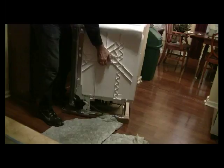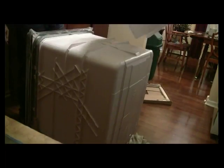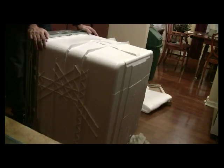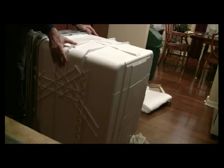These are pretty light. I'm just going to pick this up and set it right like so, making sure I'm on the pad itself. This does have a thermal pad. You can take it off and lay it to the side for now until after installation, but make sure to wrap that again because it keeps the heat contained on the dishwasher body.